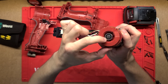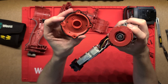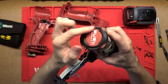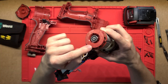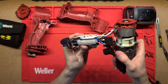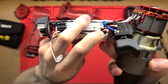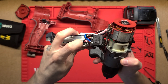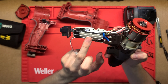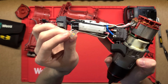There's a really nice sealed bearing here — there's another one between the motor and the gearbox — which holds the motor in position. The motor spins at quite high speed so these are high-speed bearings, while inside the gearbox there are lower-speed, higher-torque ones. There are also some pins covered with silicone — these were likely used for programming or testing the board during manufacturing. The LED for the work light is just a two-pin positive/negative connection going into the handle.